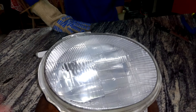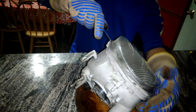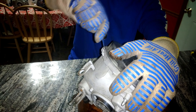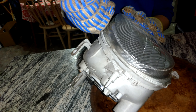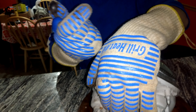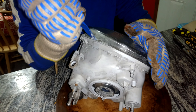The housing and everything is going to be hot, so you're going to want to wear something to protect your hands. Use a plastic tool to pry — remember, no metal tools because metal is just going to chip the glass. The rule of thumb is if it's not coming apart easily, don't increase the temperature, just increase the time because increasing the temperature could shock the material, but increasing the time is just going to let it get to that point where everything is nice and gooey without going too far, since we're really just trying to melt the glue.